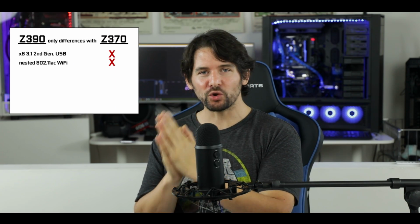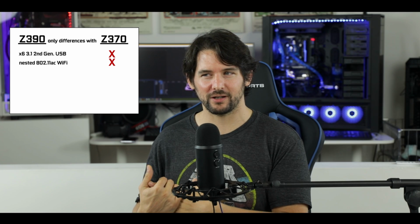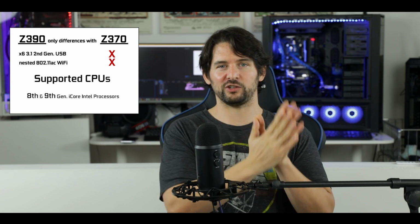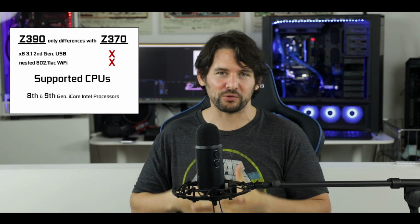But, there's always a but, the Z390 chipset which powers this motherboard is so identical, give or take a couple of details, to its predecessor, the Z370 chipset, that I don't see how you'd warrant an upgrade and dropping another $240. They support the same processors. I mean, one can argue that because of the VRM, if you use a 9th generation Intel Core processor on a Z370 chipset, you'll lose some 10-15% performance. But even in this case, I still don't see why you'd make that expenditure.